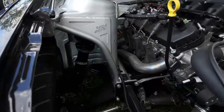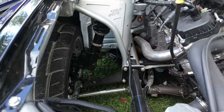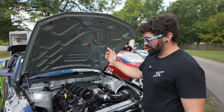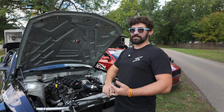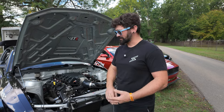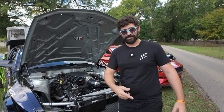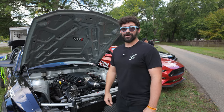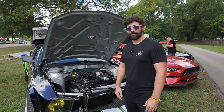We built this car in-house, me and the whole team. We designed this thing top to bottom, full CAD — everything from the tubular front half, the tubular back half. Of course it's got our proprietary Synergy Race Development angle kit on it, the GT500 big brake, hand brake and dual caliper brackets, anti-squat brackets, and our billet upper control arm with adjustable instant center.